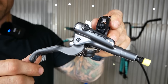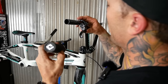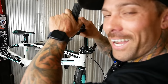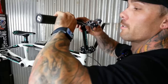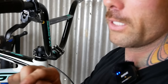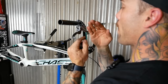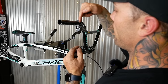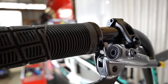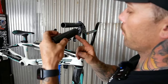That is a good looking set of brakes — carbon lever. We're going to throw some new ODI grips on, but I forgot — what would a Brandon Jones video be without me cutting or drilling into something? My guys over at Chase just hate when I do that. These XTR levers — I'm assuming since how the reservoir is made, if you fall, you don't want to break that. If you run your bars kind of narrow like I do, you push the grip in and it only goes to that stop. So what I like to do is mark it, cut it, and that part will actually go over my grip. Let's get to cutting.